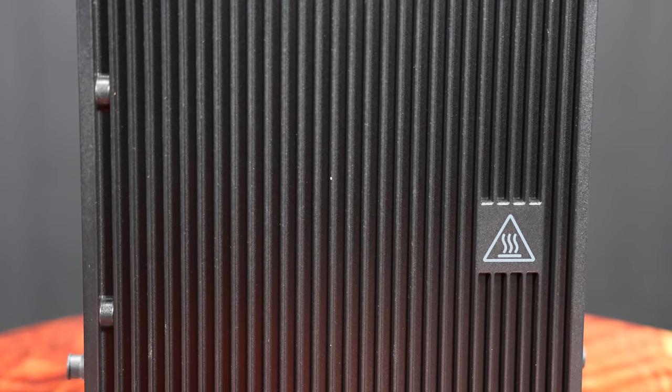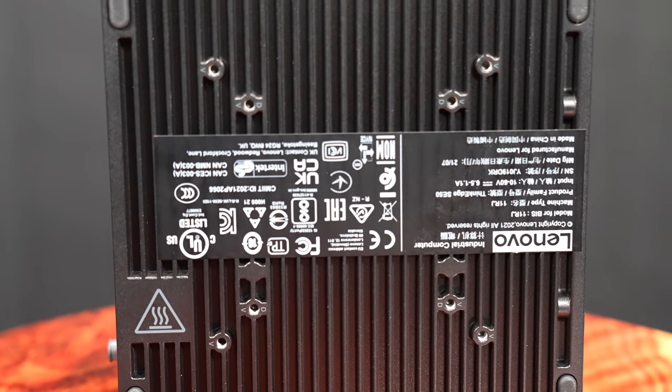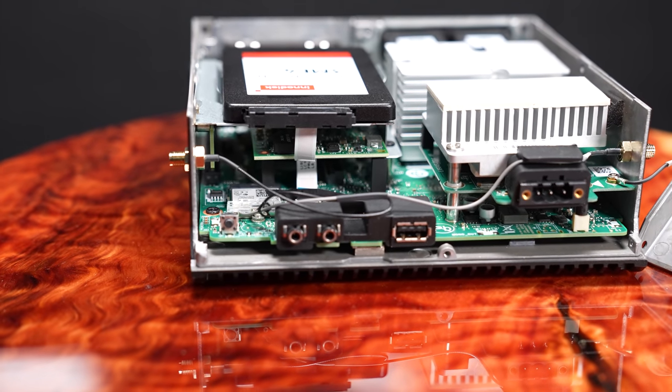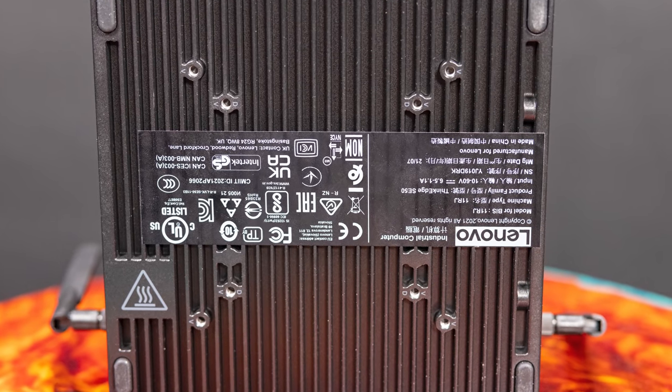While making our way to the rear of the chassis, you'll see a caution hot label and a couple of mounting options. This does have a whole bunch of different mounting options. It is passively cooled, so there's no fan inside — and the basic idea is that you can put this onto a factory floor. Fans on a factory floor tend to get a lot of dust and other materials, causing failure, and you don't really want your IoT box to fail. So passively cooled is exactly what this is. It does get hot, and we'll talk about the performance impacts later. You do get a lot of mounting points — things like DIN mounting, with plenty of hard points.